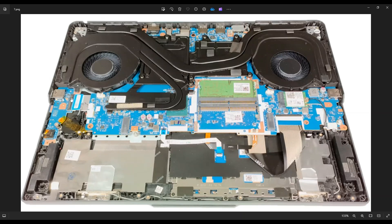The next thing is your CMOS battery toward the left of the computer. This little CMOS battery is wrapped in black electrical tape and held down by double-sided tape, so if you need to replace it you can pop it off pretty easily. If you're here just to reset BIOS, you don't need to physically remove the battery — just unplug it from the motherboard and leave it unplugged for 15–20 seconds. Keep in mind this will not reset your BIOS password; it'll only reset your system settings for BIOS.